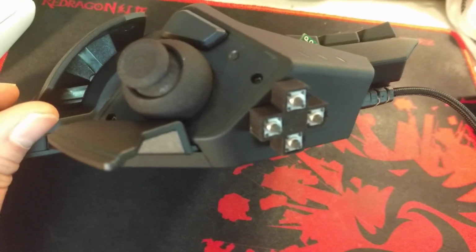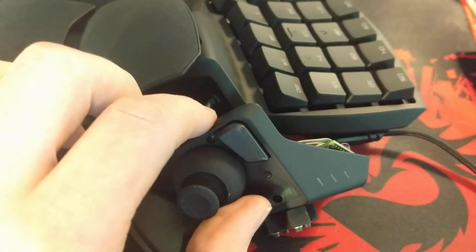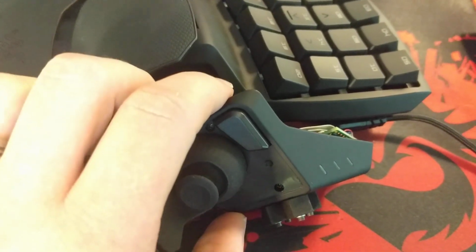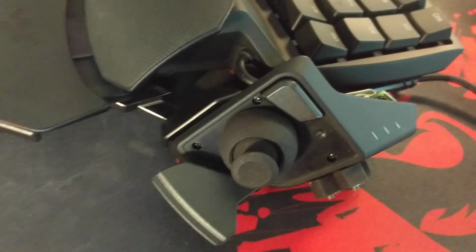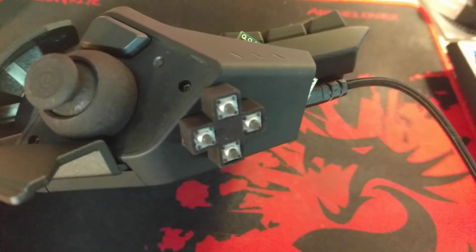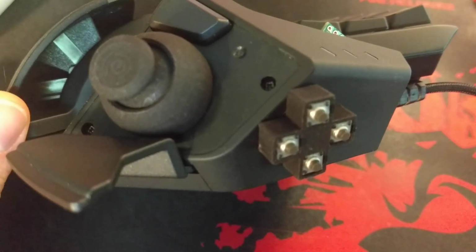So for those of you who have watched my previous tutorials, you'll know that part of the process is the PCB on the inside of this, where the factory Dpad is. We remove the switches, and we don't discard that PCB, but part of the mod is removing the factory functionality around the Dpad, right? Because you're taking switches off the board and you don't put them back. So that's always kind of bothered me, and I never had a good idea or a good solution. And I'm not sure that this is good. I think that it's satisfactory. There might be a better place or a better thing to do. But for now, this is what I've got.